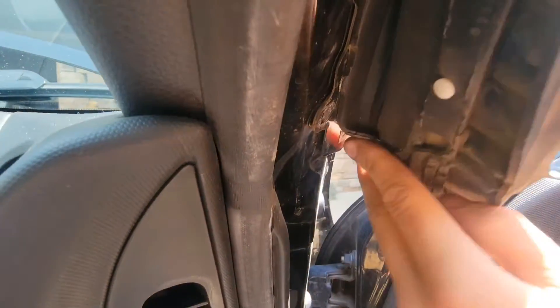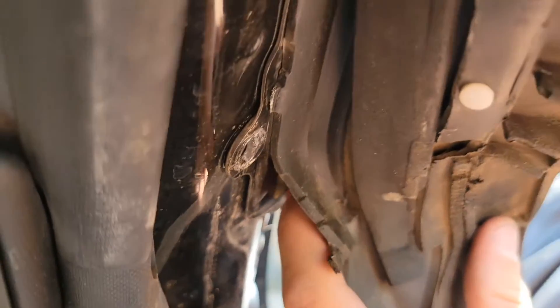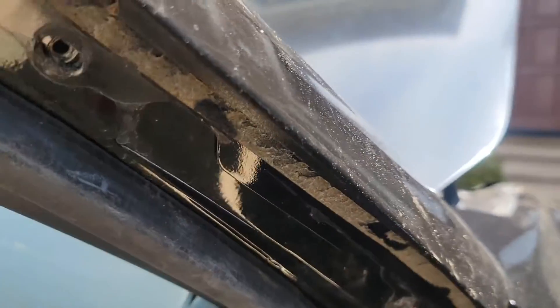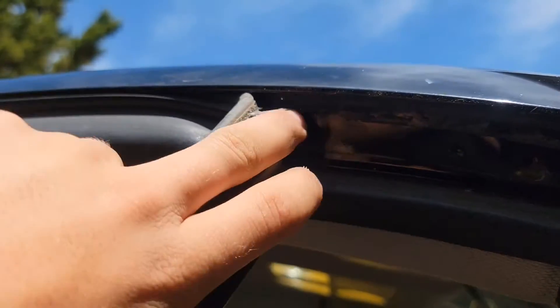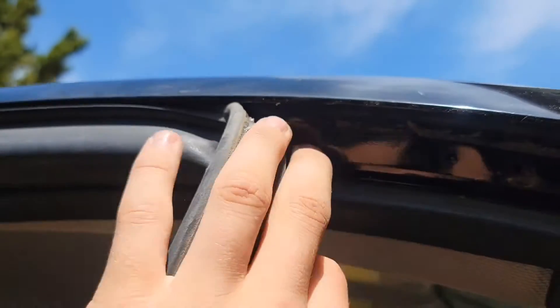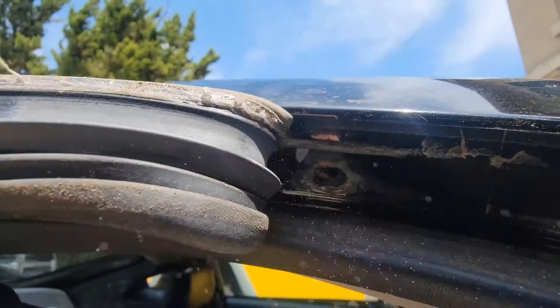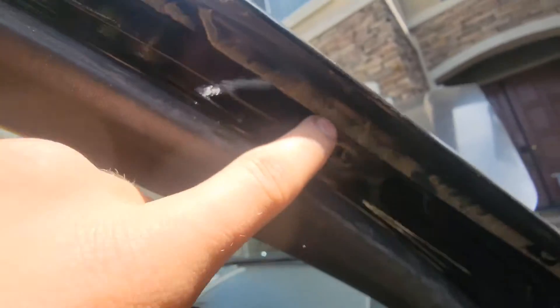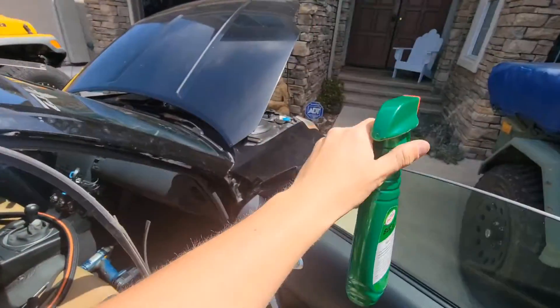What we're going to do is get a heat gun. You don't have to — it comes off — but the heat gun helps us get the adhesive off in the end because we're trying to get all of it off so when we stick the new one on we'll have the best contact. Since this is plastic, just make sure when you're pulling this that you're pushing pressure on the plastic right before you're pulling, because otherwise it will pull the plastic out and possibly break it. Just hold with your fingers and pull at the same time. It's going to leave all this residue.